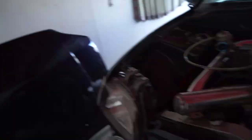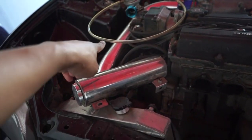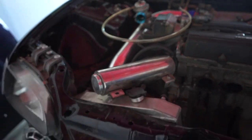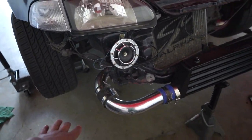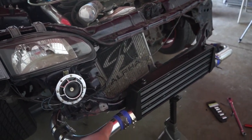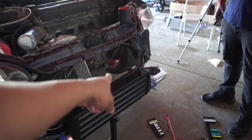Cal is already helping me with the process of installing the turbo. We removed the header, the intake, the hood, and the bumper, and now we're starting to install everything. We already have some of the turbo piping in — that's for the intake — got the blow-off valve on already, and we're getting the position of the intercooler. This side is mounted, all we have to do is get the mounting position for the bottom of the radiator. It has two mounting brackets, and we've got to drill two holes — one on each side.